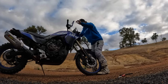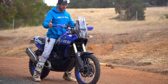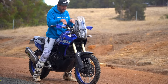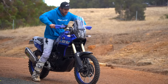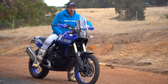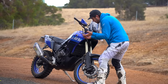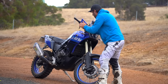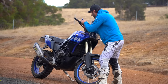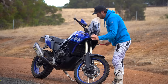That's the best way to center your front end. You can do this on the side of the track — most of the time you can check it by looking down, you can see the fork legs and your axle. The best way is when you're riding leaning over the front. When you're in the bush, just nip things up — you'll get a feel that there's not much leverage there, so you're not over-tightening anything. That will let you finish the day's ride, then get your torque wrench out in the shed at home.